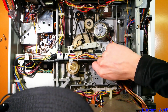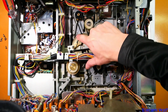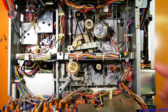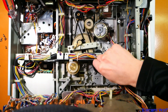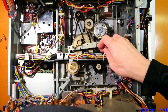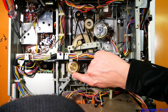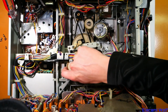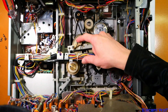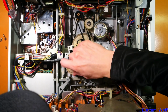Well, the reels as well. It's got a flat belt, drives this flywheel for capstan, and it's got this long square belt which then goes here to that first pulley thing on the other side, and it's got a takeoff from that, the pulley there, which takes the drive over to this. There's some multi-way clutch thing, and then there's another little roller that runs on the capstan flywheel, and that brings more drive over to there.